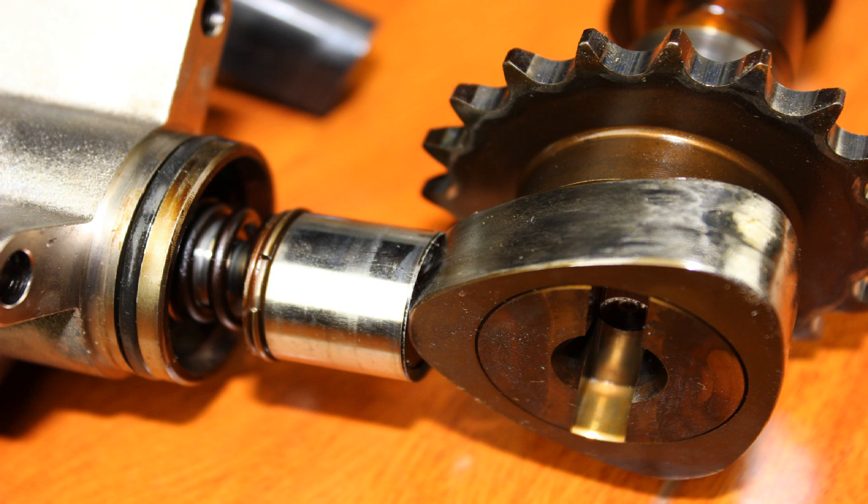This one was an extreme failure where it wore all the way through into the high pressure fuel pump. That doesn't happen every time. If you can catch it early enough, you actually don't need to replace the high pressure fuel pump — you would only replace the follower as well as the camshaft. We can also go in with our scan tool and monitor fuel pressure via measuring value blocks, but again, this visual check is way faster. If you have any kind of fuel pressure related faults, this is probably the issue, though it's not the only problem — you can also be dealing with the in-tank pump or the fuel pump control module underneath the back seat. But it's so fast to take this off and these are so common to fail that most guys just pop this off and take a look.